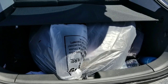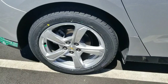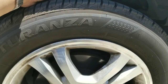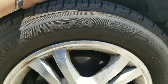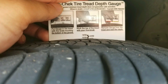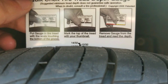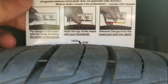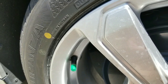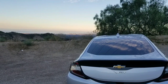So what I did was I went to Costco and there was a $129 off deal for Bridgestone tires. I bought myself four Bridgestone Turanza Serenity Plus extra load tires. The reason I chose the Serenity Plus was because I had them on my 2007 Accord — they came new with 12/32nds and after about 40,000 miles they still had 8 or 9/32nds of tread left. So it's a long-wearing, high-traction tire. They say it's a green product but I honestly can't tell the MPG hit — I'll talk about that later.